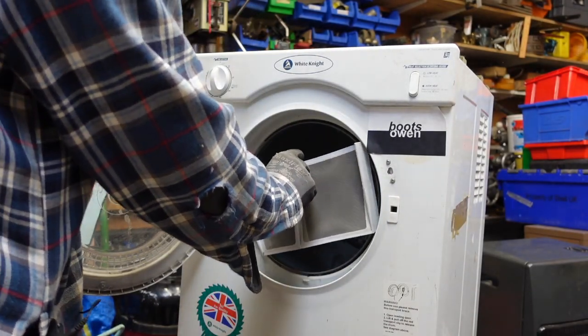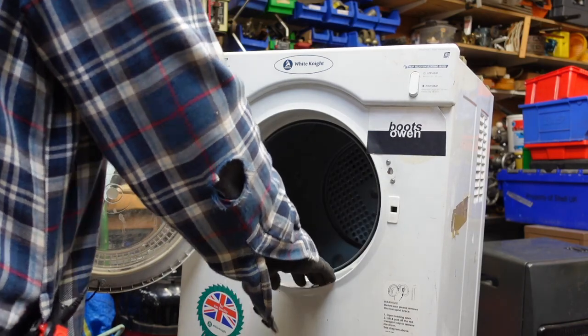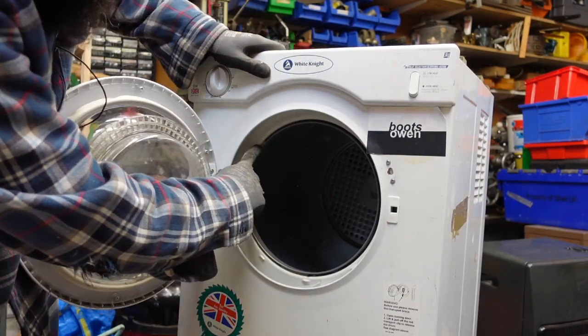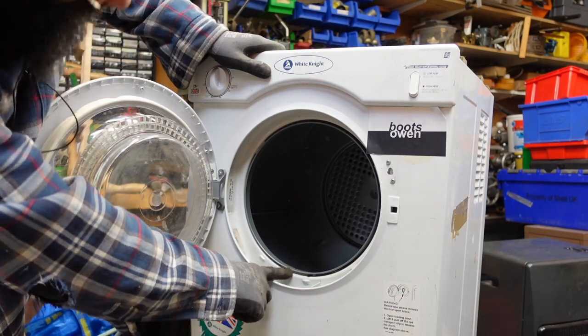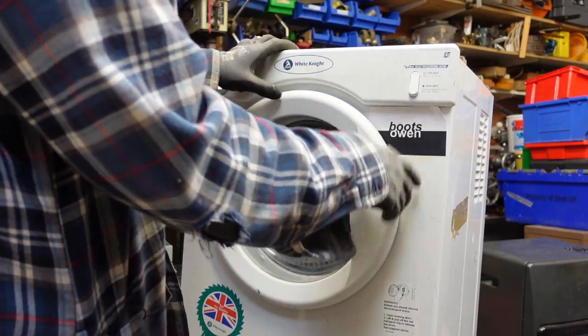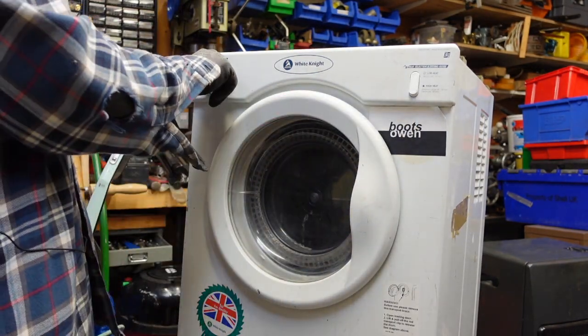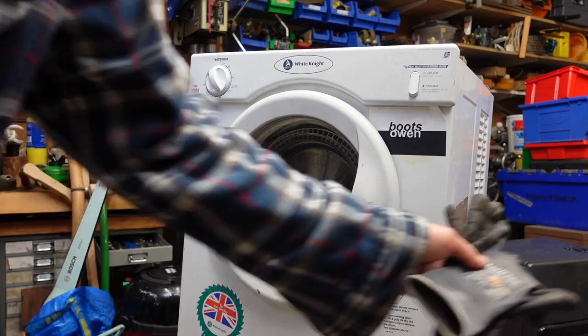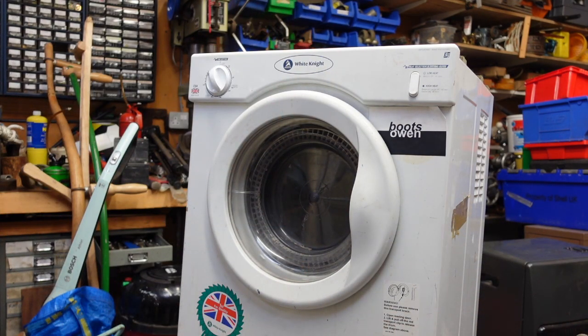Okay then. I've cleaned out the pipe and the ductwork as best I can. I've checked the thermal fuse. The machine itself feels okay. There's one, two and probably three — yeah there it is — a little nylon rubber bushing or something. So the machine doesn't have any bearings as such, it has bushings. Right, it's on low heat, it's turned on, it's working. I can see it turning on top. So I'll let it get hot for a few minutes and we'll check if the low element is working. And then after a few minutes I'll turn it on to the high heat and we'll check if the high is working.